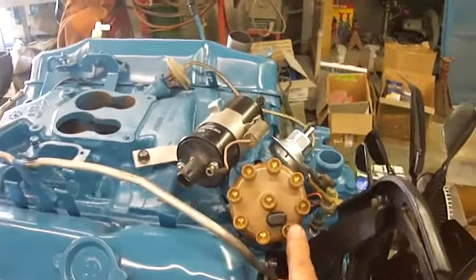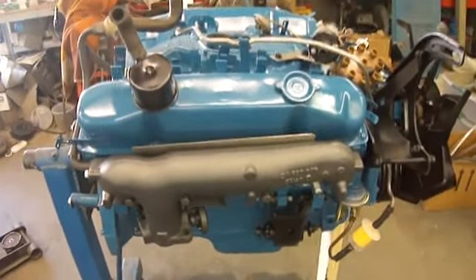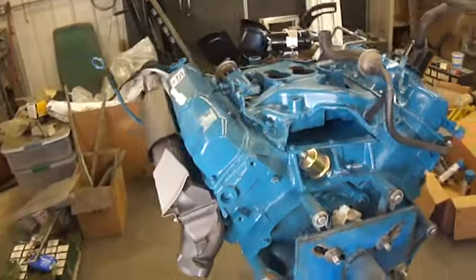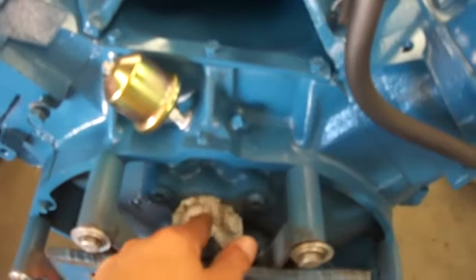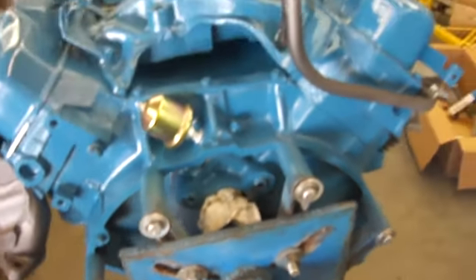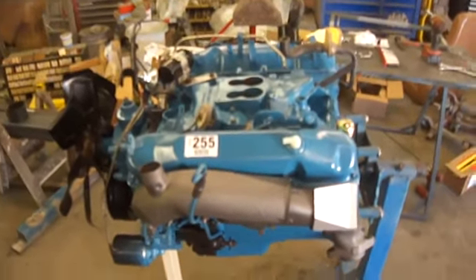There's a fair amount of juice underneath between them cylinder walls, so I think it's going to be good. I've got electronic ignition on here now — get rid of the lean burn. The lean burn doesn't go well with that kind of high output. The transmission is rebuilt already and it's just sitting on the floor. The only thing I've got left to do when I get it on the ground — I've got a little dolly I built for it — is this frost plug right there. Obviously you can't get in there and get that put in when it's on the stand. Hopefully the next video of this will be when it's in the vehicle.